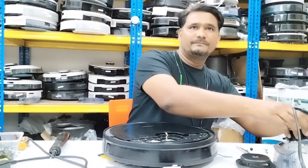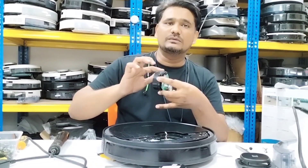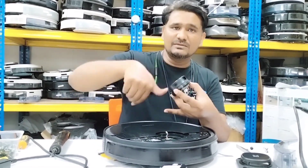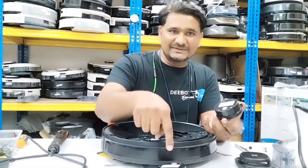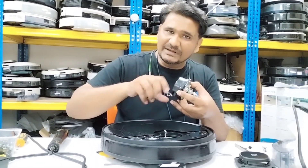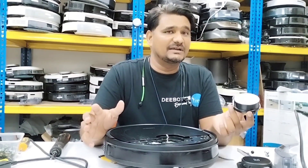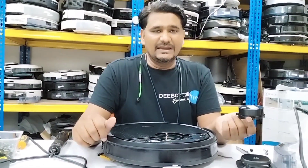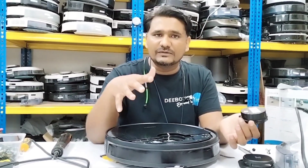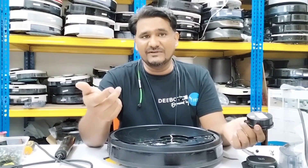Now here is a new one. When we turn this one, there is totally no sound — it has a new bearing inside. It is completely silent, and it can turn many more rounds than the faulty one. When you turn the new one manually like this, there is also totally no sound — it's very quiet. So this is the actual reason the LDS is not functioning: manually it appears to turn a few rounds, but after that it stops or cannot build a proper map, which is why it gives the error.